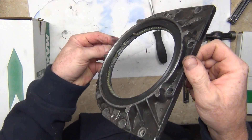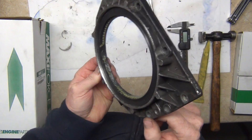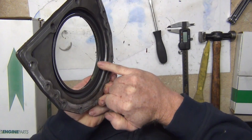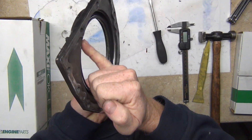This is a pre-greased seal. Before I put it in, because it goes on this way, the main thing you want to do is make sure this lip right here has grease on it — that'll help it go on smooth. Otherwise you've got metal on rubber and it grips and it can tear.